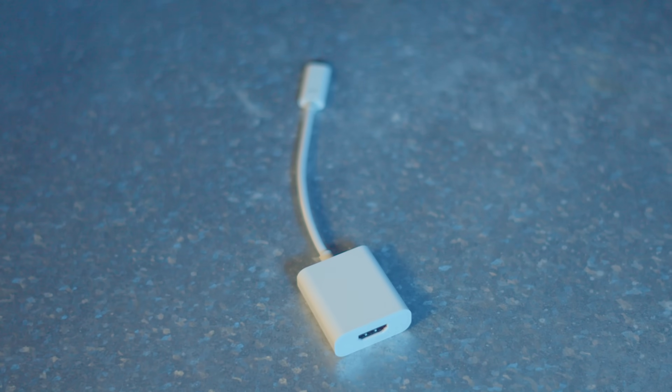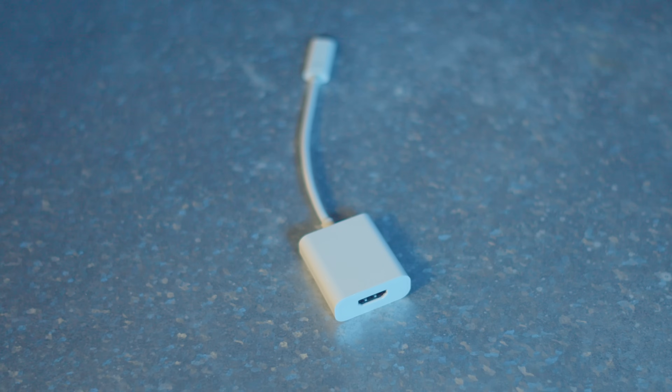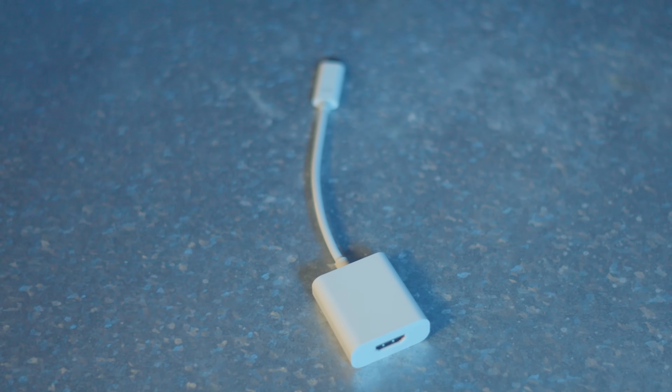If you're going to pick up a hub for yourself, there are several things to watch out for. First, don't bother with cheap USB to HDMI cables unless you have a very specific purpose for using them. While many will definitely work, generally speaking you'll want a hub that supports USB power delivery as well as HDMI out. For it to adequately power the Deck, it should support power delivery up to at least 60 watts. It's safe to use more, and a higher power delivery rating will allow more devices to be connected to the hub at once.